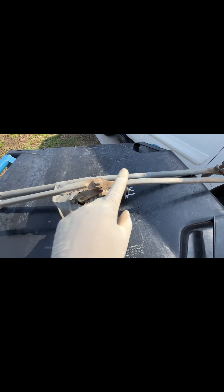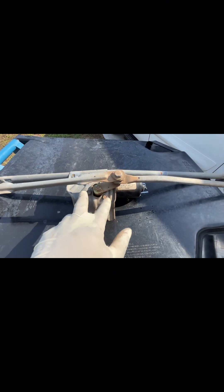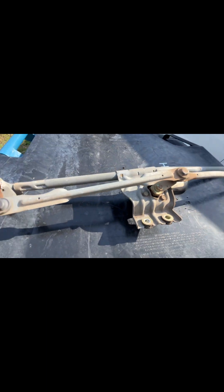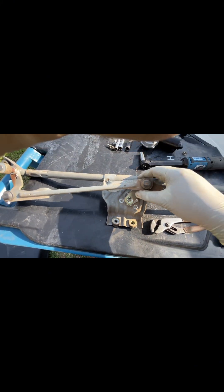Once you take this nut off, the track is technically free, so when you put it all back together you've got to get it back in place where it was so everything lines up. Take this nut off and the three corresponding bolts that hold it to the bracket, pull it off, replace with the new one, and go from there. On this application there were three 11mm bolts around the base and one 13mm in the middle. You can see how the track flexes and moves — you'll have some leeway. Just know when reassembling, you may need to use the interior controls to move the motor to position the wipers correctly.